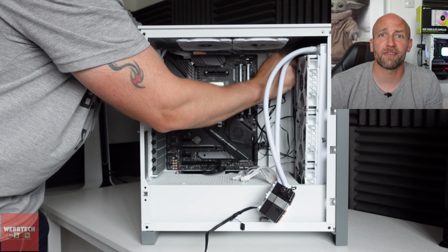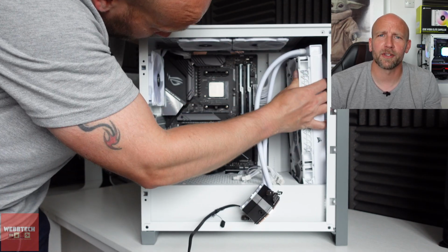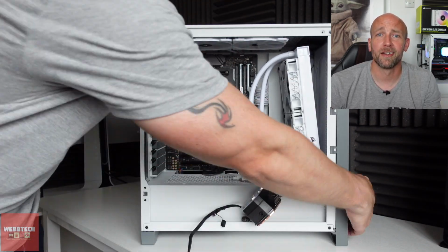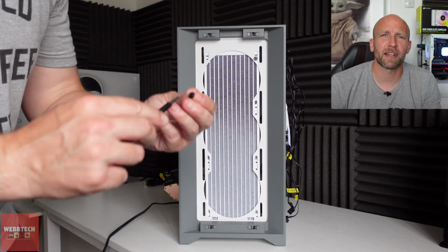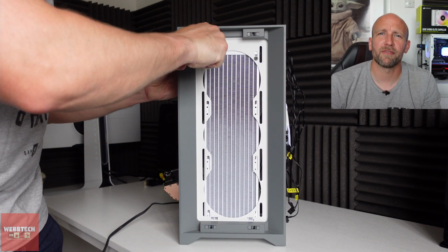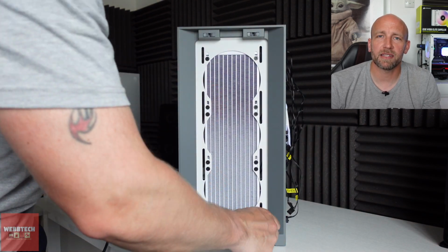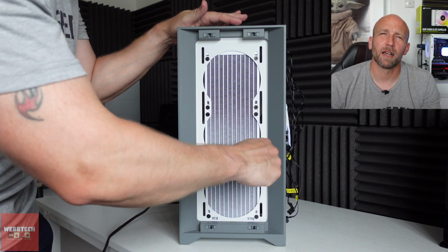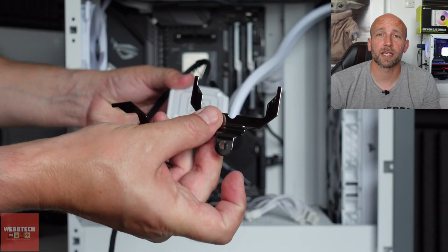So when it comes to installation, it's fairly straightforward. You put the fans on there, you stick it in your case. In mine, which is the Corsair 4000D Airflow, I can only put it in the front, so that's all I'm doing. I've put it on a pull configuration because I think that's best. The GPU definitely benefits from a little bit more airflow. Push, yeah, it's okay, but you definitely see a reduction of the GPU temperatures by maybe 1 or 2 degrees, certainly in my experience.